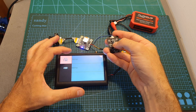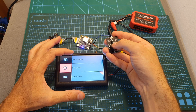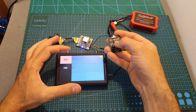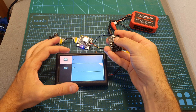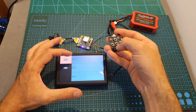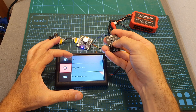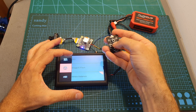You can set the frequency to either 50 or 60 Hz depending on your country. TV mode can be set to NTSC or PAL. The HDMI output can be set to 1080p 60fps, which is the default, or 720p 60fps. OSD mode can be turned on or off. The logo watermark is on by default so the Hawkeye image will appear on your videos — I'm just going to turn it off. The ISO value is set to auto by default and can be changed to other values. You can set the image effect and the white balance, which defaults to auto but can be set to predefined settings.